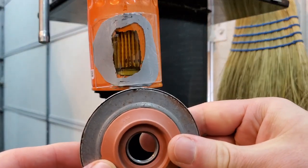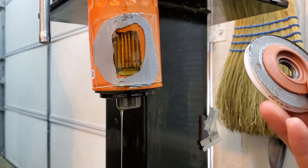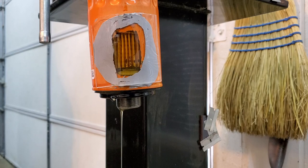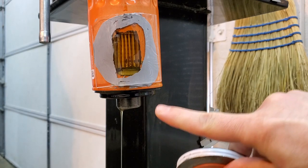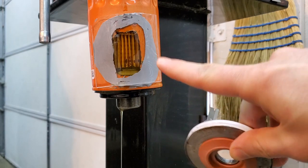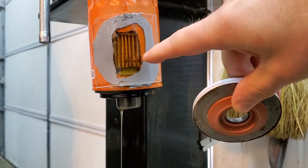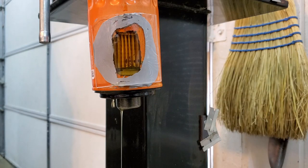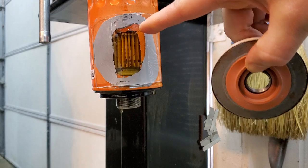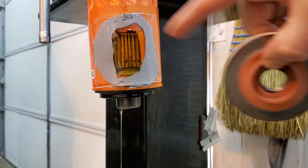It's supposed to prevent oil from draining back, but you can see the oil is still draining. It's not doing the work — well, it's working, but not working well. The oil is coming from the center hole, which is the return hole, but it's still going through the filter media and escaping through the center hole. You can see the oil level is dropping — now it's about half of the filter that has drained.